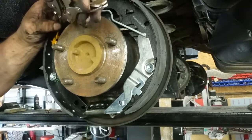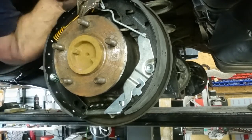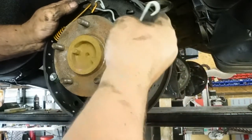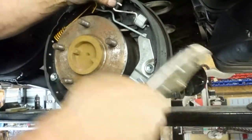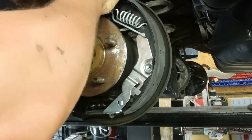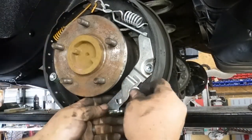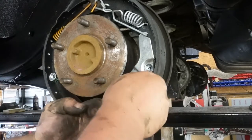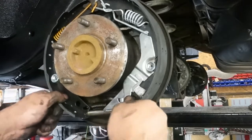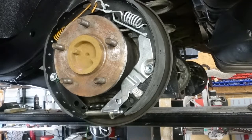And this is what I use vice grips for normally. I'll just grab the vice grips like here, make sure that's over enough, and just pull it up and clip it on like that. Now that holds all that together. Okay. Now we're gonna grab the short spring. That one goes right in here, and that goes on the self-adjuster wheel right here. Same thing. Just pull it up into place. Like that. Okay. Now the only other thing we got left is the self-adjuster spring itself, which goes up underneath here, and you can kind of get it up over the top of that and compress it in. Now that goes down, it spins a little wheel, and I usually just give them a little wiggle here like that, and that's how you assemble rear shoes.